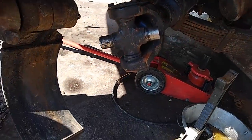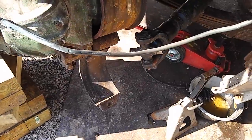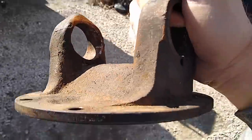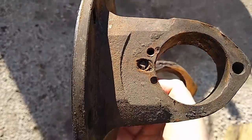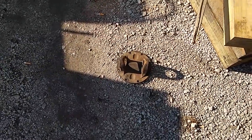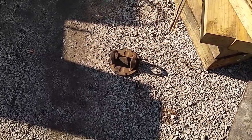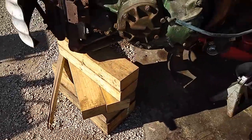When I was here parking it in late November, that drive shaft flange actually pulled out. We broke the U-joint and it kind of ripped out. The flange has got some problems — there are two holes right here, and when we were in Belpre we discovered it had been snapped off with a makeshift cap put on it. The flange itself should probably just be replaced. Finding one of these is a unicorn part. I have a Spicer dealer who does differential parts, and I'm hoping he can find a flange that works.